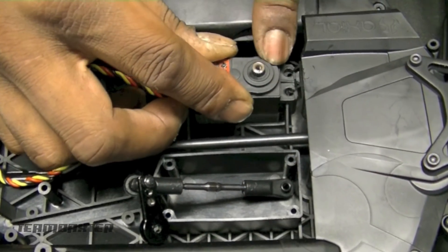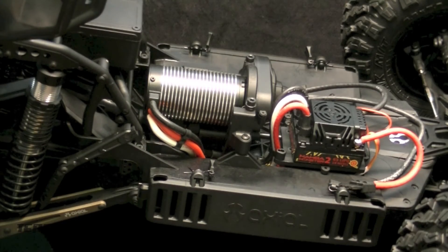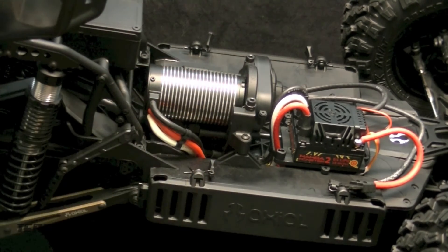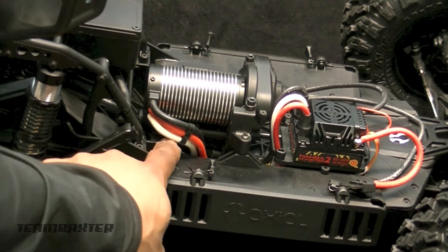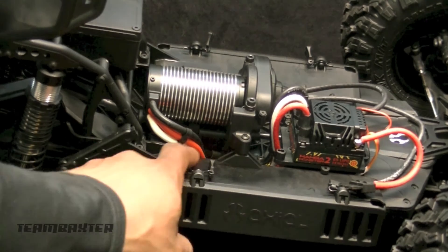I used a stronger High-Tec servo for the big wheels. The Mamba Monster has a built-in BEC to accommodate the high voltage of this servo, and I've got that turned up just a little bit to help the servo out. The 2200kV motor is sitting on a really nice gearbox, and it seems set up mostly for a two-speed right now. Right underneath the wires there's a slot for another servo, and the servo mount is actually included in the plastic parts for the Yeti XL, so the two-speed should be pretty easy to drop right in.